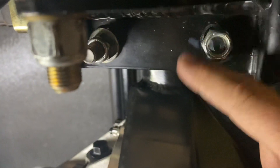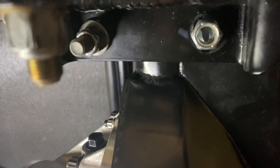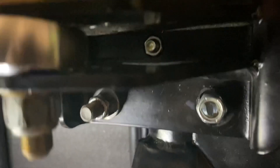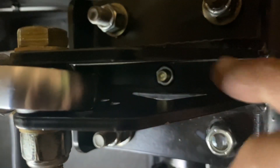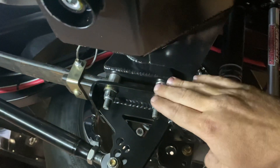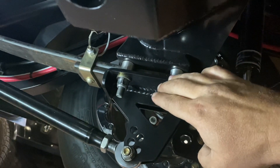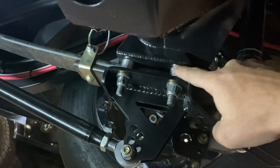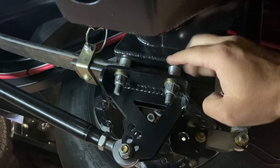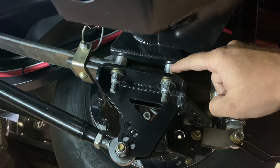The plan to fix it: first, I have to take the whole thing apart because we damaged a thread on this stud, so I have to cut the stud out of the housing and reweld a new one in — not the end of the world, but I've got to get the housing all the way apart to fix it. Second, I'm going to triple up — or at least double up — on these studs right here that locate the axle, so I'll have double if not triple the amount of 3/8 locating studs that hook the axle to the leaf spring. I'll also make the clearance correct by grinding all the powder coat off.